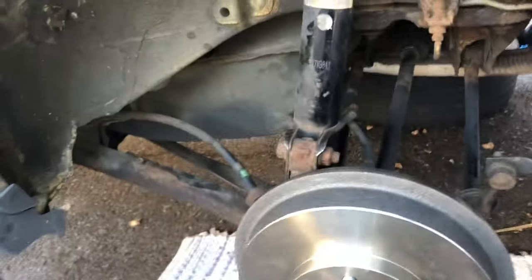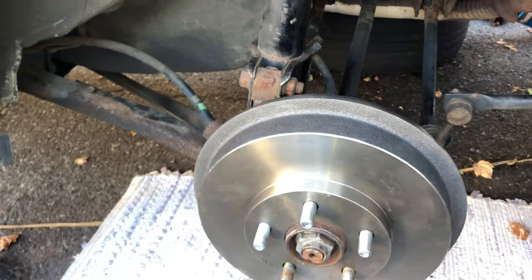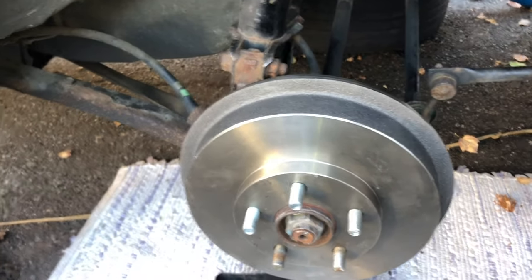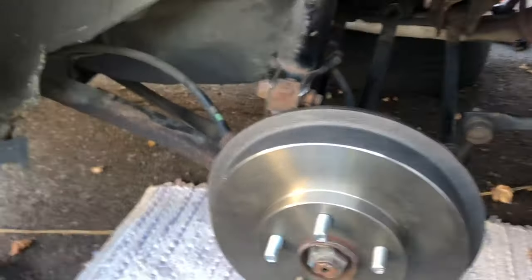There is two ways to bleed the brakes. There is a tool, it's called OneMan Bleeder tool. I'll post a link in the description. Or you can use the old way. You have your buddy pumping the brakes inside the car while you bleed the bleeder screw here. So you wanna get 8mm.